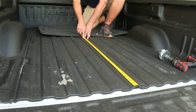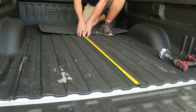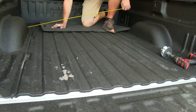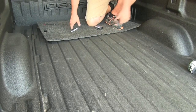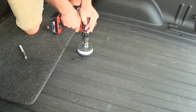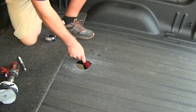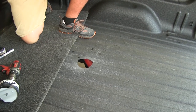Now we want to mark out our drill mark. Make sure you use the mark for either a long bed or short bed depending on what you have. Per our instructions, we'll mark from the back edge to the center point and then from the center of the vehicle. Now we're going to take a four-inch hole saw and drill down through the bed. Once we have our hole, we're going to clean up the area, file out the edges from the bottom side, then take some black touch-up paint and cover up all of our bare metal to ensure we won't have any corrosion problems.